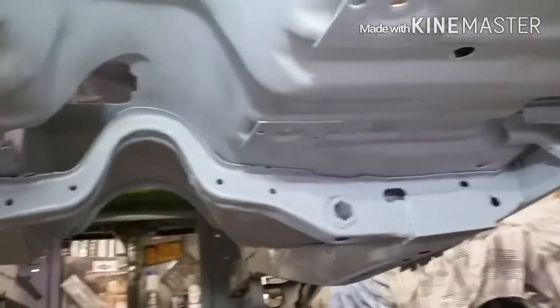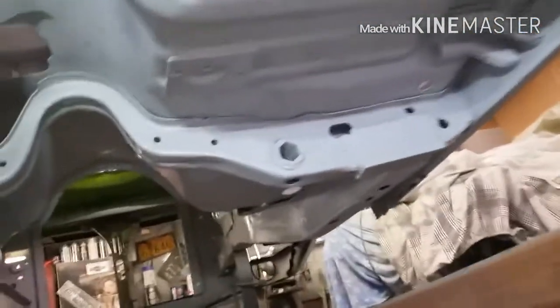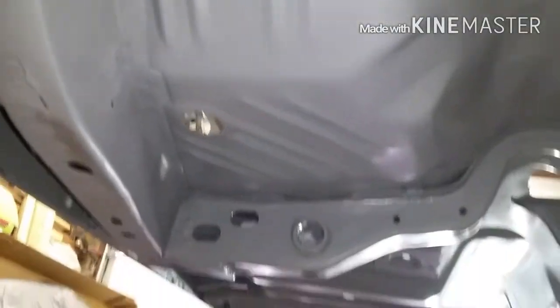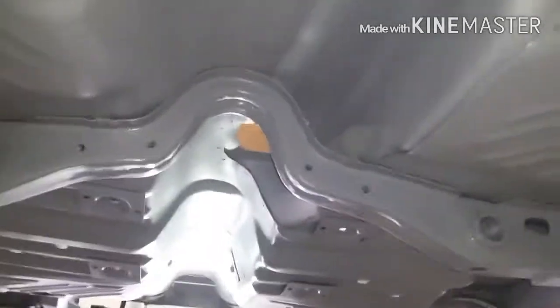We're back on our backs giving you a shot of the underside — lighting's kind of poor, but the ugly is now gone. I'm not going to get too crazy; I'll be seam sealing everything, filling all the gaps and little cracks. I need to buy some more seam sealer, but other than that I'll give it a light scuff and paint it once the top side's ready. I've taken my fancy stand and jacked her up in the air so I can roll around underneath — makes it easier to make the ugly look pretty.